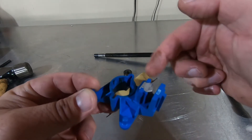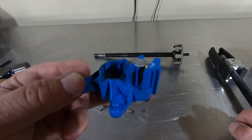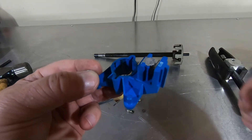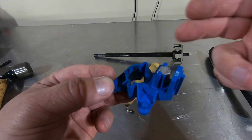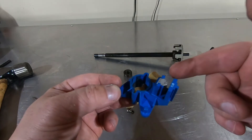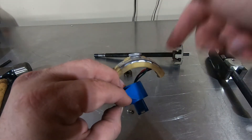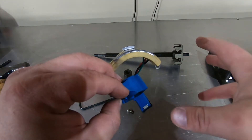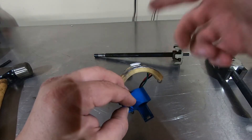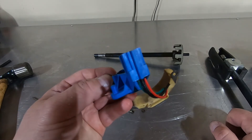This is the pickup you want to use — a Ford Motorcraft part number DU-30C. These are the pickups you want in these distributors. Obviously they're Ford Motorcraft, they're going to last a long time and not leave you on the side of the road. The magnetic pickup is right here — this is where life starts for a TFI system. It's got a positive magnet and a negative pole on the other side. When that reluctor wheel passes through and the magnetic field collapses, a voltage is induced, sent to the TFI module, which sends it back to the computer to adjust timing, control injector firing, and send it back to the coil and injectors.